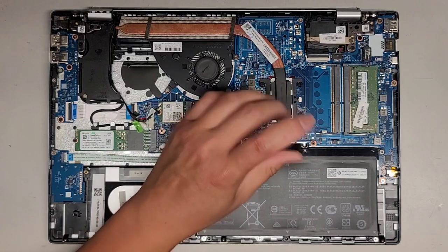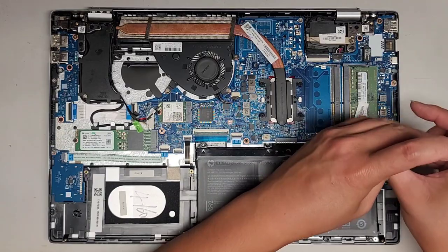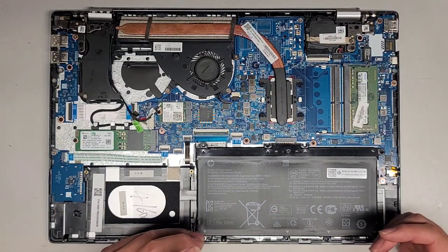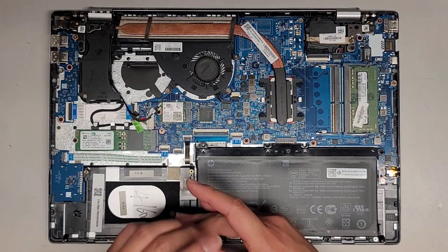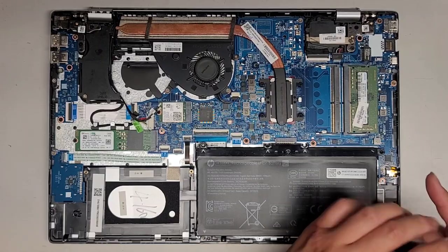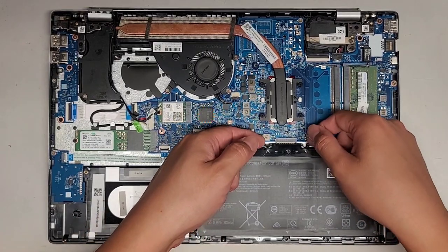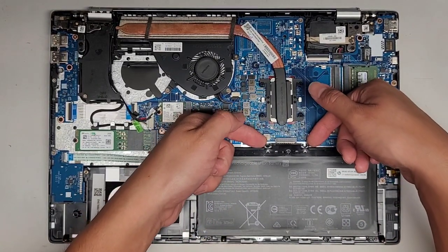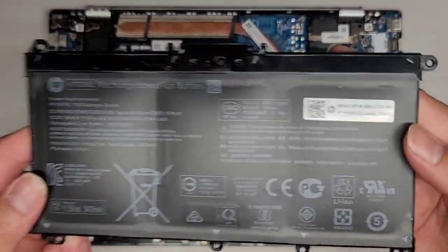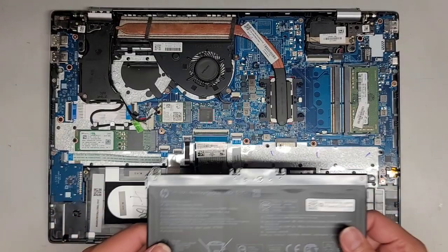Let's go ahead and get the battery out. First thing I'm going to do is repair the hinge with some JB Weld — that kind of thing has to sit overnight, about 15 hours, so it's going to take a couple days for this to be repaired. I'm going to have to order a battery as well. Once you remove the screws, you have these spots here — just pull straight up and you can take the battery out. This is the battery — model HT03XL — and you can see it's all inflated and bloated.